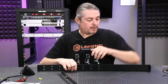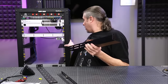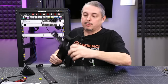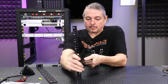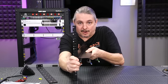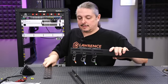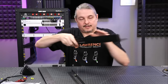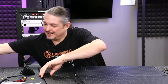The specs are down below. You put all the screws in here. And I do really recommend one thing though, and you'll notice I've done that with these. There are all four screws in it, not just two. I mean, it probably can hold quite a bit of weight, sheer weight, when you put it in with just two. But the reason you really want to put four is if you only put it with two, and you set the server in like this, it'll kind of tilt down because there's nothing to hold that top part in. So make sure when you put these in, you put four in the front and four in the back, because if this starts coming in like this, and because of the way these are, the server may catch on the screws going in, because these will tilt in and you'll get it stuck and it'll be very aggravating. Save yourself the aggravation so you're not standing there mid-holding a server and dealing with that.